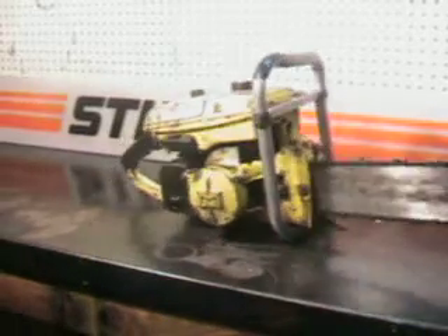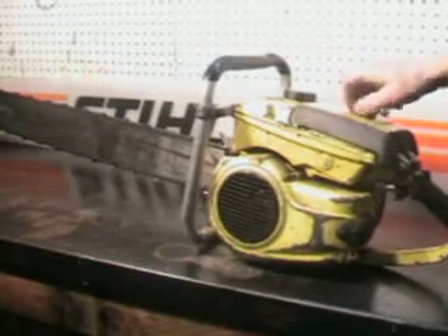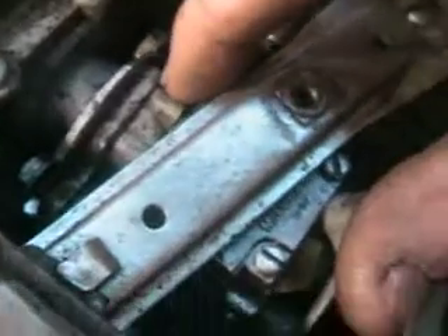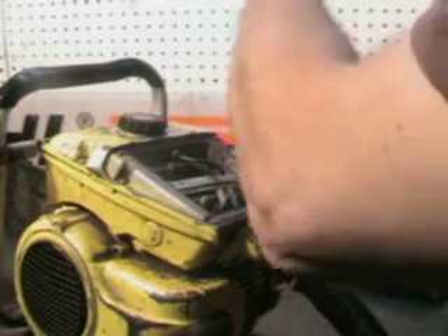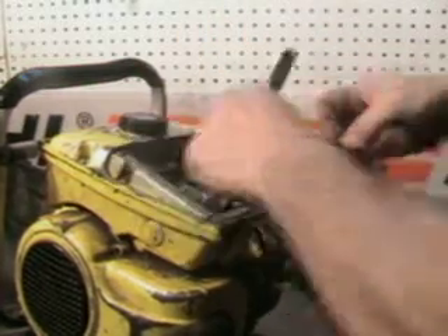I want to show you something pretty unique about this saw. They had a lot of trouble with the original carburetors, and back in the later 60s you could buy an adapter and change out that carburetor to one of the newer carburetors for that age. You can see that adapter right here. That made it possible to put on a very popular carburetor — let me take that cover off. See that newer style carburetor in this older saw? That flange right there you could put on there. Made that a real nice feature. That saw just purrs and runs beautifully.